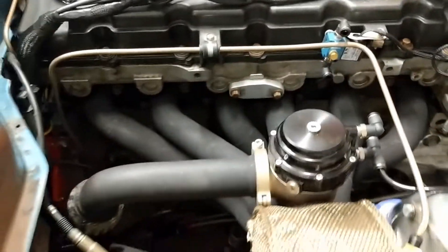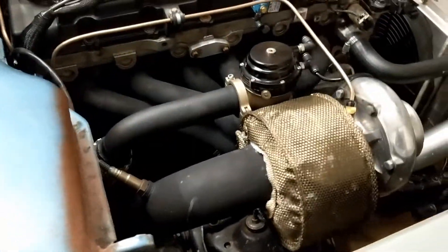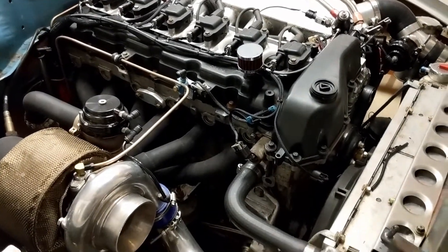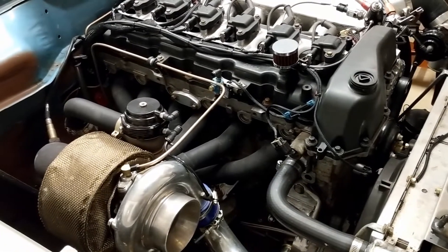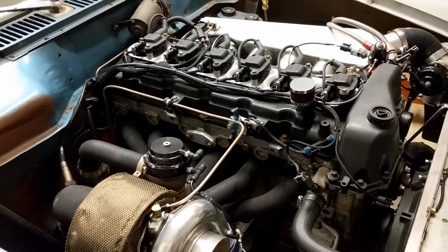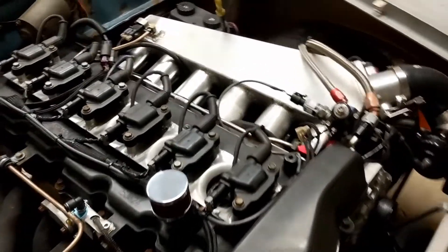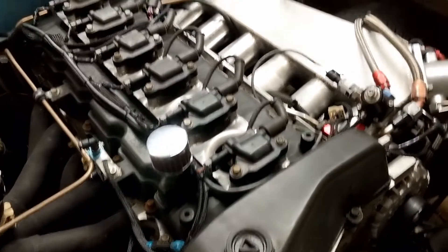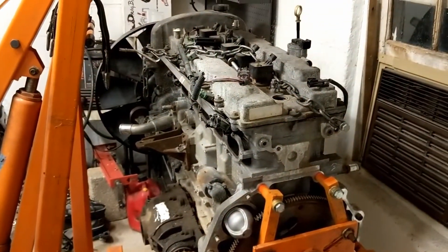I'm going to be relocating that and hopefully I can get my boost controller to actually control boost. On 18 psi, I was planning to go there anyway — this thing moves, it's a lot of fun to drive. I want to do a compression check and a leak-down check just to make sure everything's cool. It won't idle right all of a sudden, and I did find a spark plug with a cracked porcelain, which baffled me for a bit, but I think we'll figure it out.